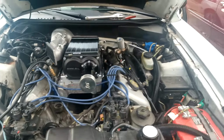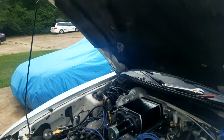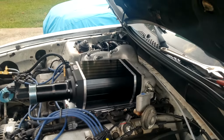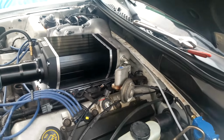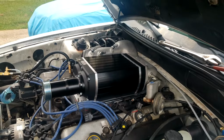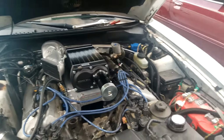I'd really like to run 60 psi, just like I do on, here's the old girl, the Marauder. She runs 60 psi. The other Cobra ran 60 psi, and I like to do the same here for the atomization and, of course, the extended injector range. So, with that in, we've got that done. I'm going to let everything settle, and I need to get some bolts because, of course, I dropped some to mount the upper plate, but she is good overall.